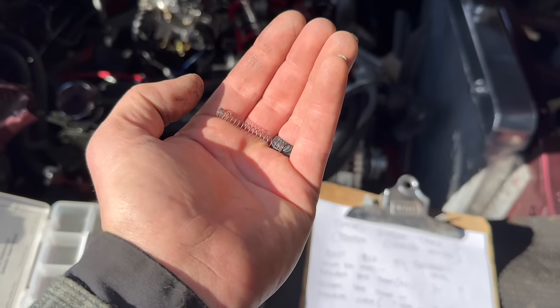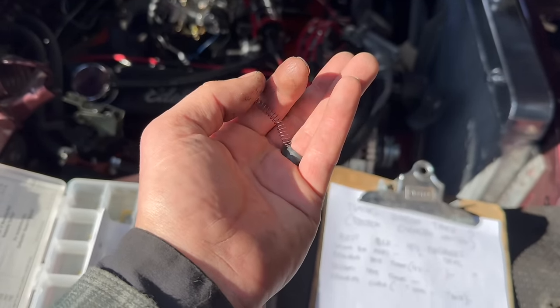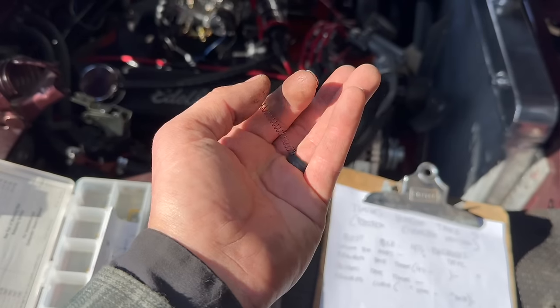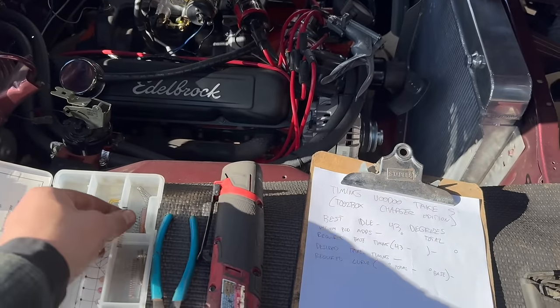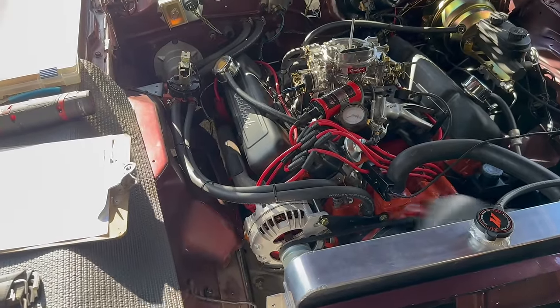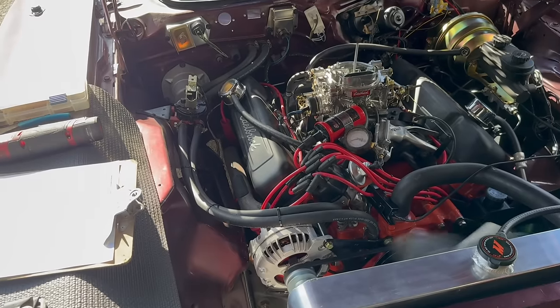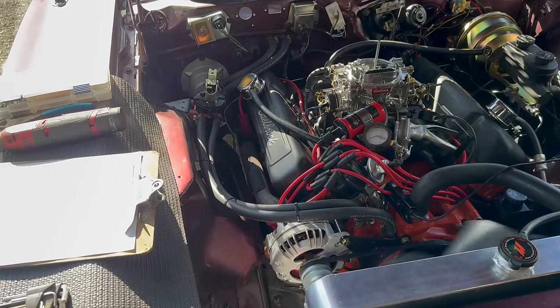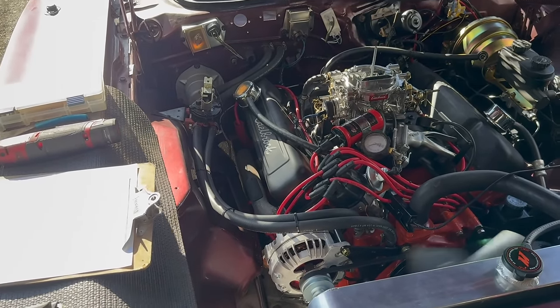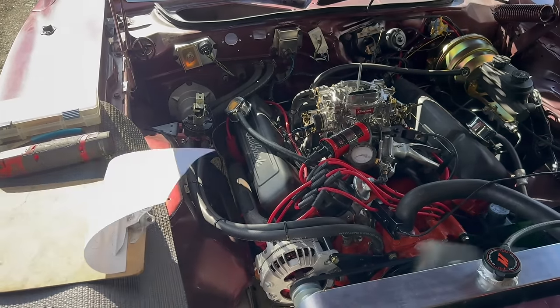It is kind of funny to realize that essentially what we're doing in there is the same thing we do by changing these step-up springs. We affect the amount of vacuum that makes the tuning change happen. Of course, the other reason we can't just leave the timing at 43 is because it starts like garbage that way. And if you remember that green '68 Coronet video, I actually ruined a torque converter by having the timing set too far advanced, so you don't want that either.